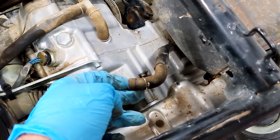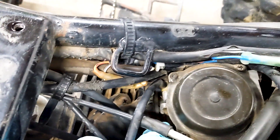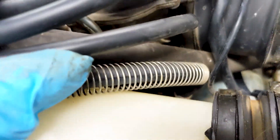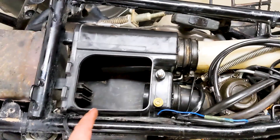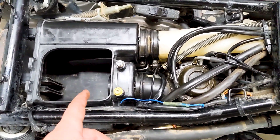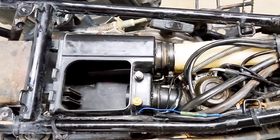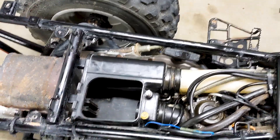One thing I missed that I had to take off when I was partway out was this breather for the rear differential. It looks like it came off the other side, and there's one on the front over here too of this airbox. Now we just have to undo that screw for the boot that holds the carburetor in place and then see what else is attached to it — I know there's going to be a fuel line and a throttle attached to it at least. So we're going to get the airbox back in. The only way I know how to do it, because they make everything fit so tight in these, is just fight and spit and curse and force it. And then after enough time and sweat, it'll give in and go into place. This airbox is a pain in the butt and most of them are.